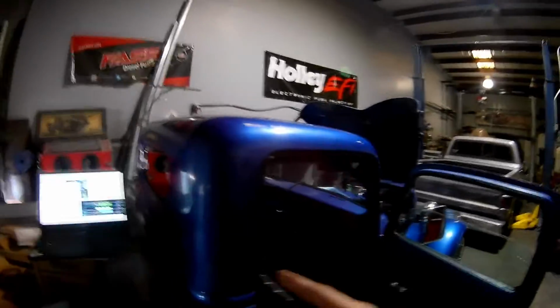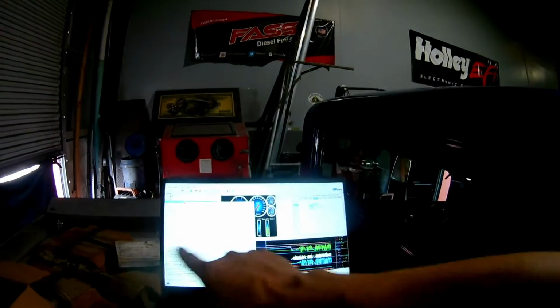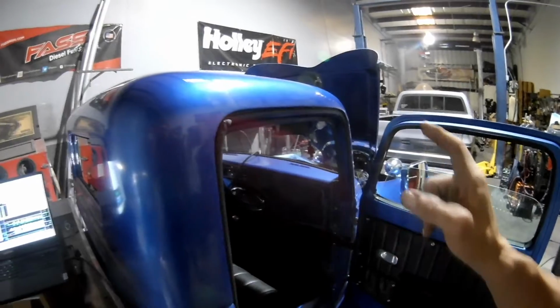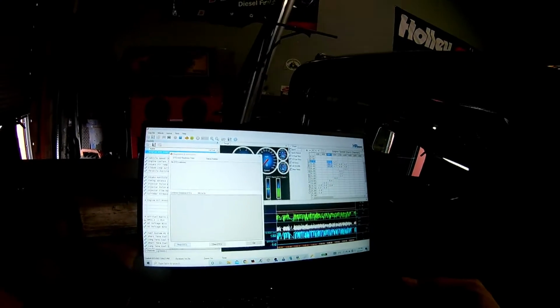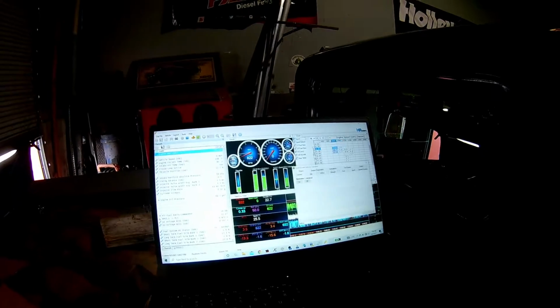Being that that was a permanent code, yesterday it showed pending, history, current. Today it was only showing as a permanent code, so that's why I had called Junior. They had actually put this ECU on and started the car. So I think that harness was definitely bad, and that's what triggered that code and put it into this ECU. But now that the new harness is on, it's not actually triggering the code, and after an ignition cycle, the code is now gone, whereas it came up immediately yesterday.